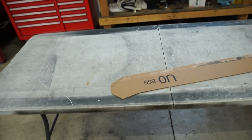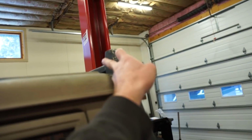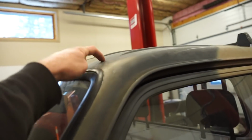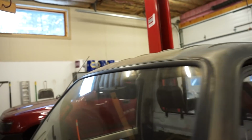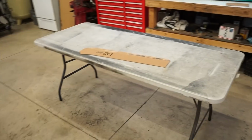And then, like I said, we're gonna bolt the light bar to it, kind of set it up on the roof, make some little mounts into here. We'll bolt it straight to that. And then I think for the front, I might just do some riv nuts into the actual roof, probably right around these corners where it's the strongest. And then maybe one in the center. I don't know, we'll see once we get that far. So let's get these made out of steel.